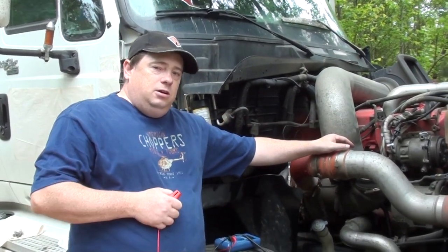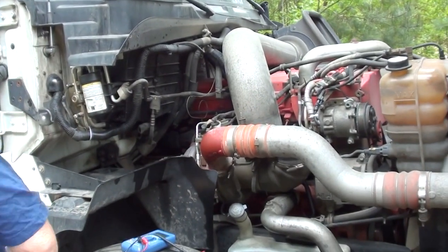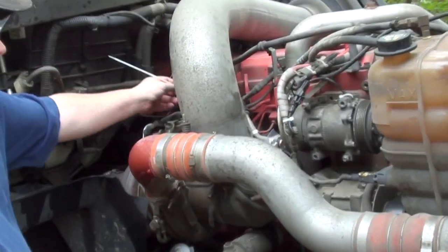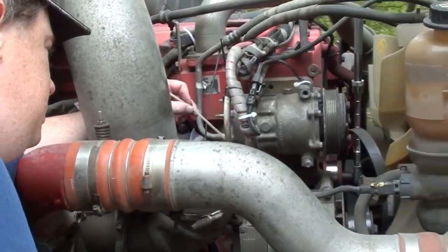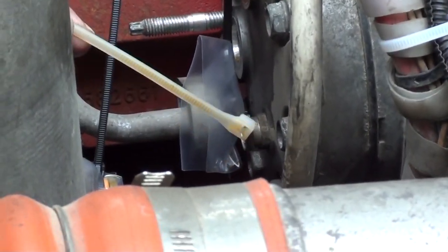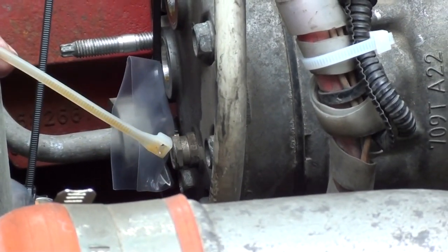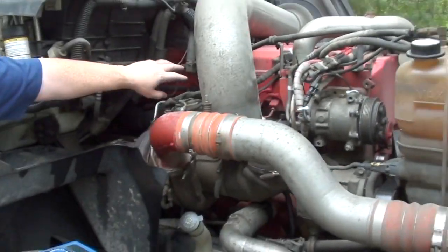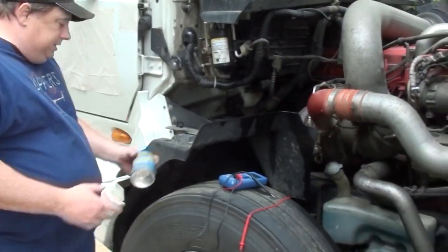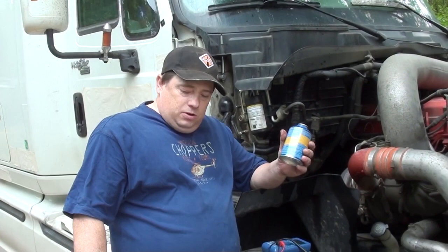I don't know if you want to zoom in over here. There is an emergency blow-off valve, right here, literally, this thing right here. Okay, you see that? Yep. That's an emergency blow-off valve for the compressor. It will blow refrigerant straight out of the back of it, all over your turbo, all over this whole area here. And the irony is that a lot of these refrigerant cans have a greenish glow-in-the-dark UV dye in them, so you can see leaks with a UV light.